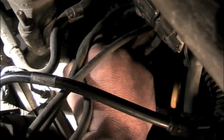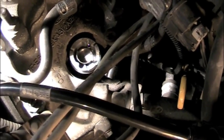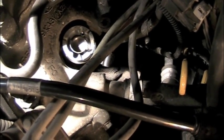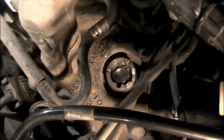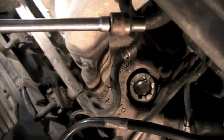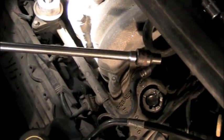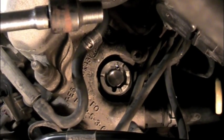Once we have the shaft and synchronizer tool in place, you can pull your hand out and we'll show you the synchronizer down in position. The camshaft position sensor should go right on top of that. Be sure and refer to your service manual — it'll tell you that on the tool there is an arrow and it needs to be pointing about 30 degrees off center. When you're sliding that synchronizer down inside the hole it may not want to fit. It's kind of like the old distributor and you may have to rotate it — get yourself a socket and a long extension and stick that down the hole to rotate the oil pump shaft in order to get the teeth to line up for the synchronizer to fall in place.